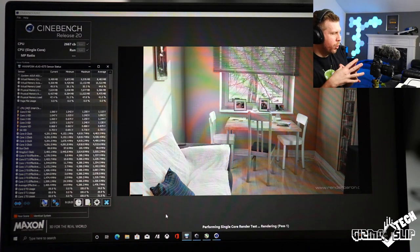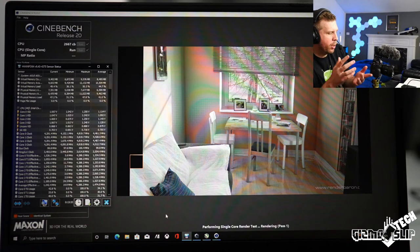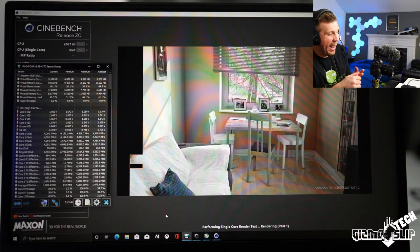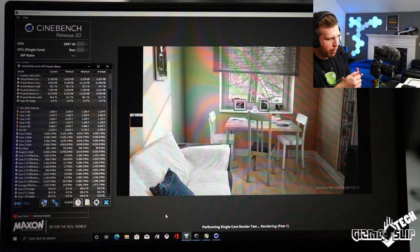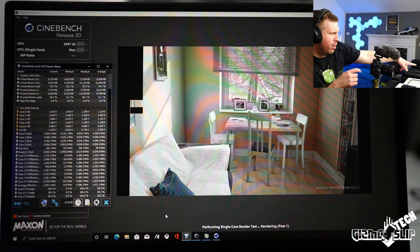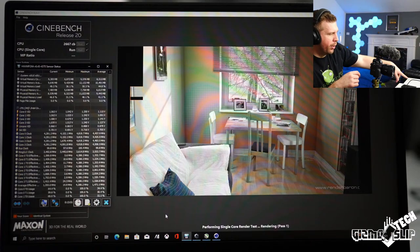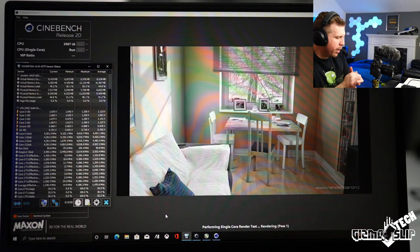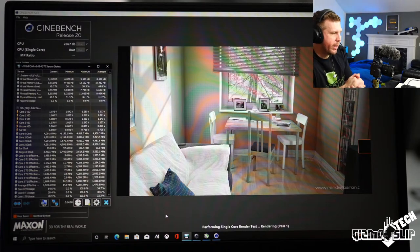In the ideal world, for maximum gaming performance, you either want to get the GPU that's the best you can get for your budget, and you want to get 16 gigs of RAM, a 144 hertz display with a good response rate, and potentially a color gamut that you really need. If you need to do a lot of creative work, I would recommend at least 100% sRGB. That's where the Gigabyte G5 is really attractive, because it has a better display, better color, and a 6-core processor versus this 4-core processor.